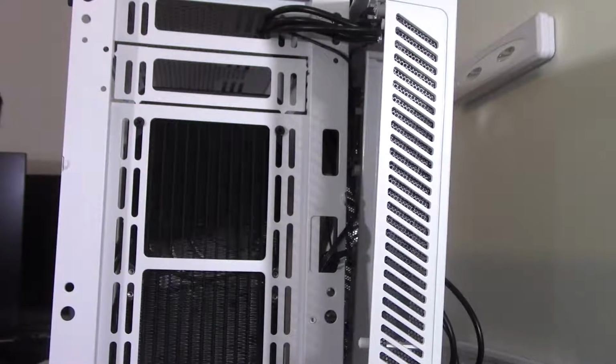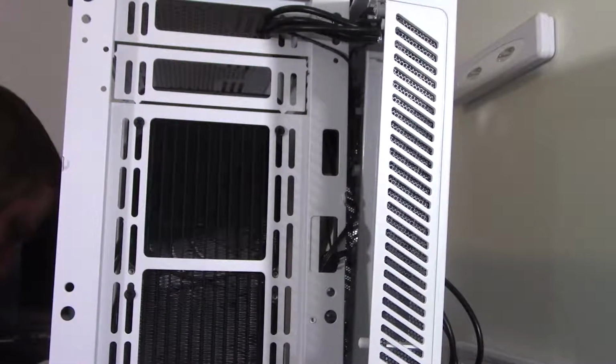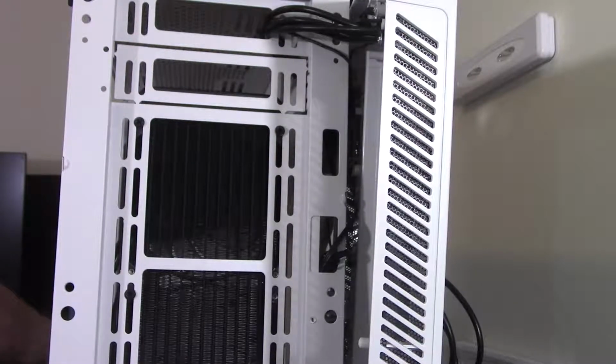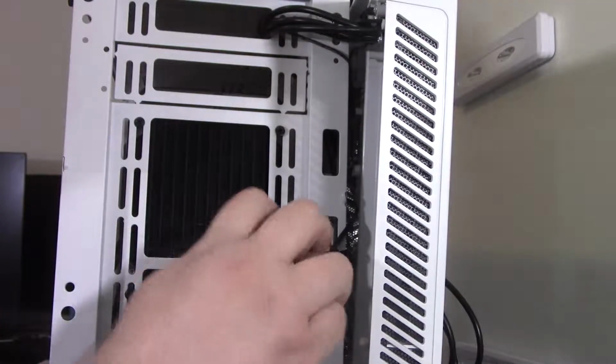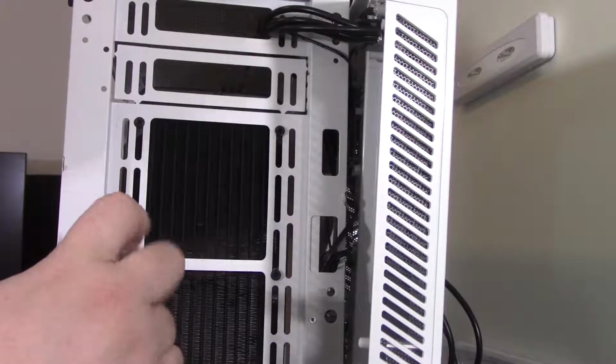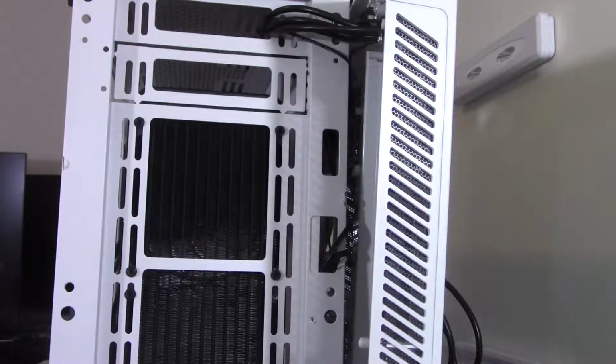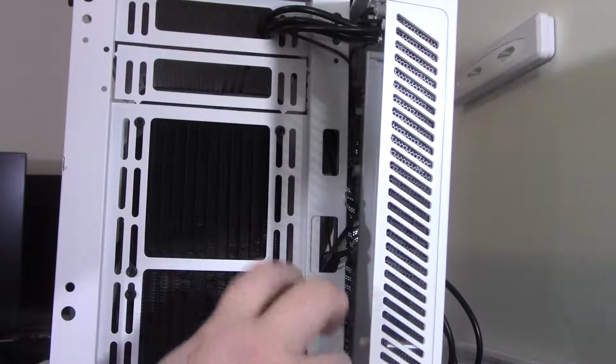So now if you're wondering how do I know which one's which, well, I've mounted this cooler a million times back when I was using it all the time, and it has not changed. The general kind of hex head screws are the ones that I used back then. It's the ones I'm going to use now. And the reason why I'm doing pull, actually there's two reasons. A, I think it'll actually look cooler, at least for the side angle, and this is somewhat filtered as well, so I think it'll be a little bit better from a filtration standpoint.